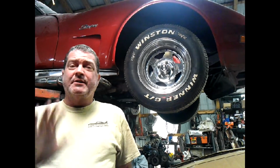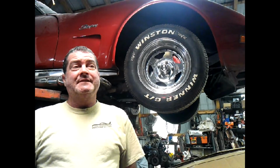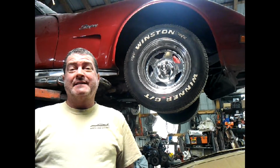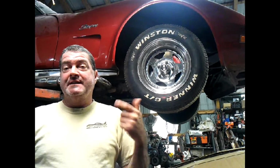Sometimes you can close the bleeder, pump it a few times, kind of get it circulating through there, and that helps too. But in reality, gravity bleeding is easy peasy. You crack that baby open, and just let it sit. It's not hard. Just let her go until she starts dripping steady. Keep an eye on that.